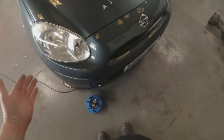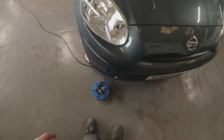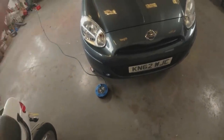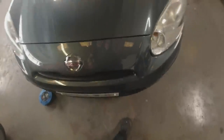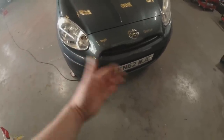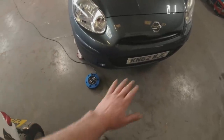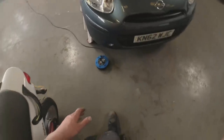So there we go - another little example of what you can do with a little bit of patience and a rattle can, a can of lacquer, and a can of fade-out thinners. Always expect slight colour variations - you're never going to get it 100% unless you've used exactly the same paint that came out of the factory on the day. Plastics always have a slight colour variation on the bumpers, but what we've done there is perfectly acceptable. This is all achievable at home, on your driveway, with rattle cans. Only thing I'd say is pick a day where it's not windy, otherwise it's all going to blow away. If you can get it in the garage, ideally that would be best. Wet the floor down first as well, especially if you're doing it on a driveway, to keep the dust from coming up onto the paint.